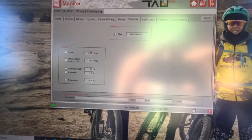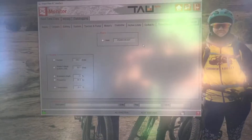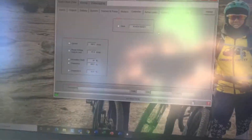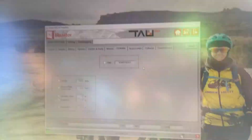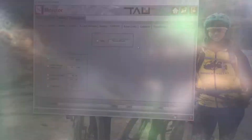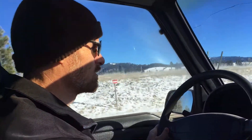A complete stop here. We're going to go ahead and make the turn and then I'll get into the throttle pretty deep. That was about 75 to 80% throttle. I'm going to go ahead and back out of it a little bit now because we're amping pretty hard. There's 50 miles an hour — actually 51 now. Pretty strong acceleration, considering there's no gear reduction other than the rear axle, which is about a five and a quarter to one in this little rig, straight through the transfer case with no transmission.